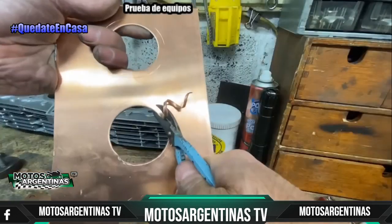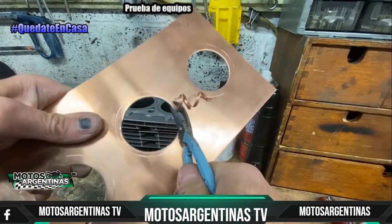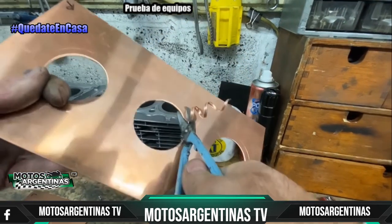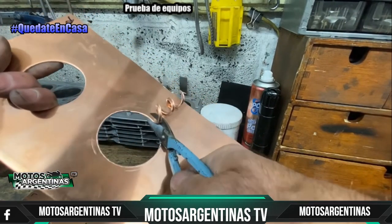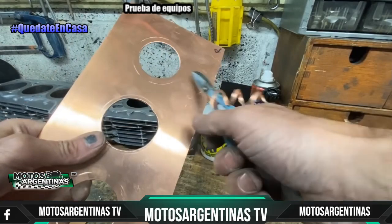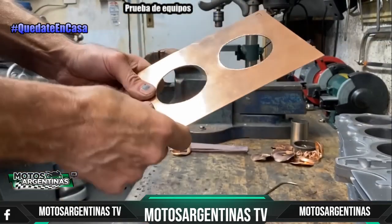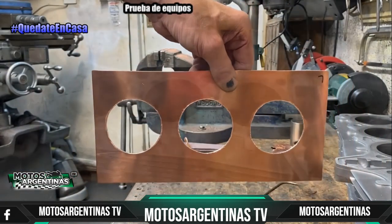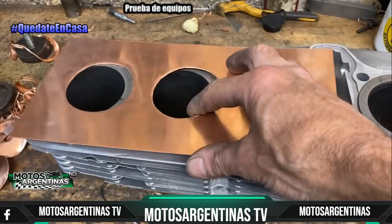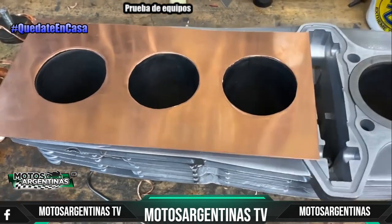It's always best to trim off a little bit at a time, gradually increasing the size to the required size, otherwise you might find yourself cutting it too big and you can't put the metal back on. Well, that's the holes trimmed to 70mm. It's now time to try them over the barrel and see how it looks. And they look great. I'm really pleased with that.